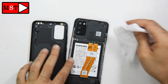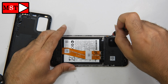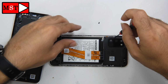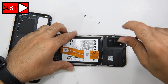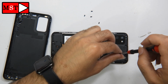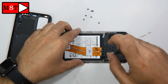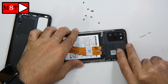We can notice the water inside the back housing and on the board. You can see on the left, there is also water. I didn't know where the device dropped, but there is no bad smell, so I don't think it was in the toilet. Anyway, let's remove all the screws from the bracket shield at the top. After that, we are going to unplug that shield.